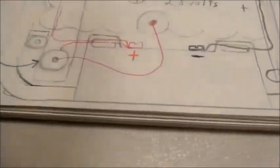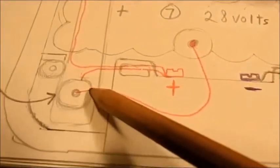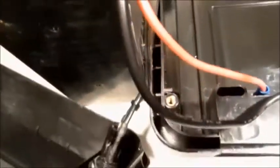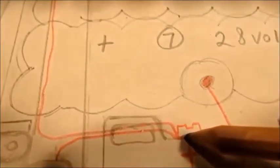Let's talk about the schematic. Start at the red — we're going to solder to that positive end right there. That's going to go over and hook to the top of the fuse. The way the EZIP comes is that the fuse is on the negative side. We're going to swap that around because the red wire is closest to the fuse. The red wire, we're going to snip that off and connect it to the tip of the fuse right there.